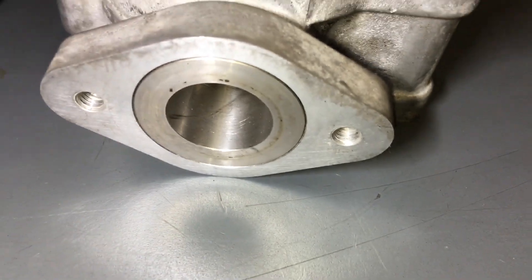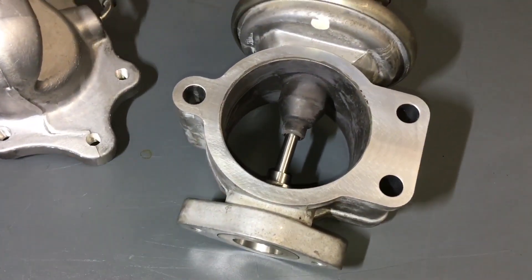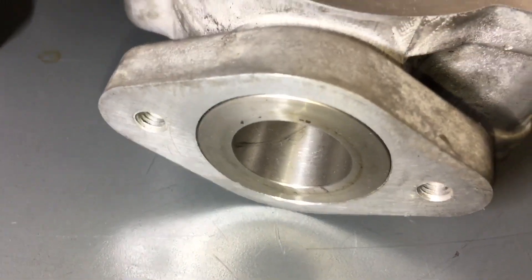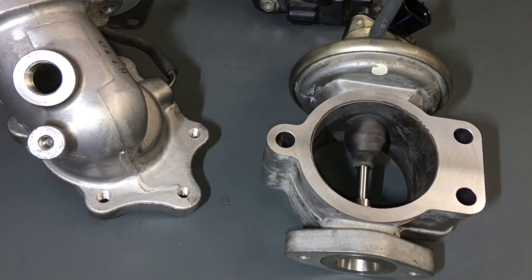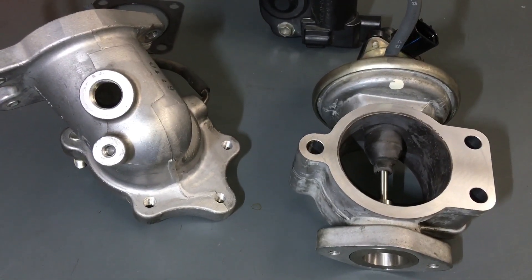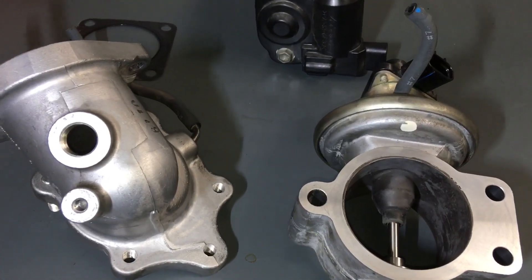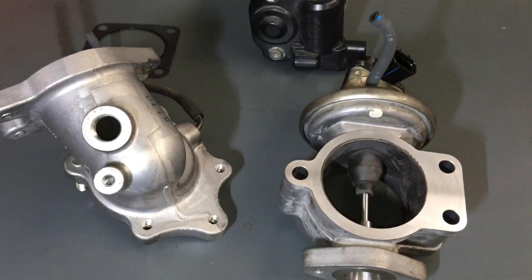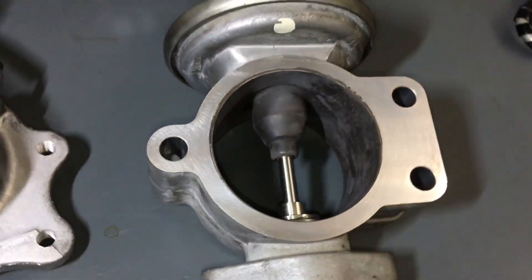If we put a plate in and didn't clear this, it's more likely to throw a P0400. But it just goes to show how much the flow can be reduced and not throw a P0400. So to get your own plate with a 7mm hole, get onto kaon.com.au — Kaon 4x4 on eBay. 7mm plate, about $12, Australian made, awesome company. Put it on your key ring in case you ever decide to put it in there, and keep doing your research to work out whether it's the oil or the exhaust gases causing the intake blockage.